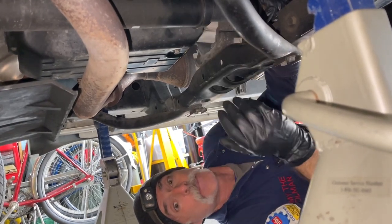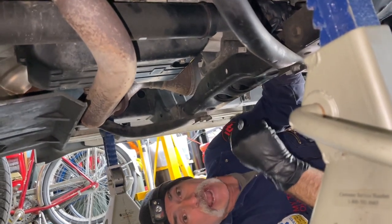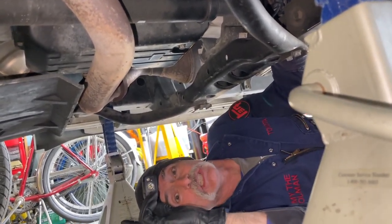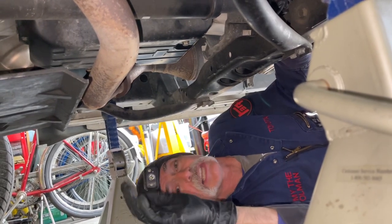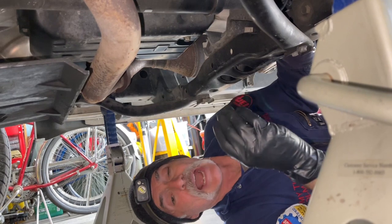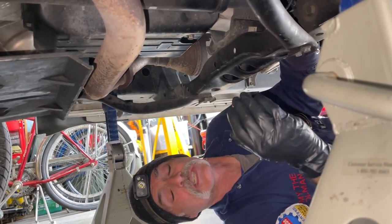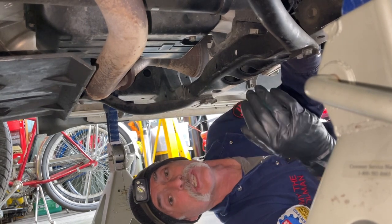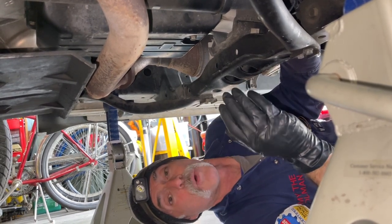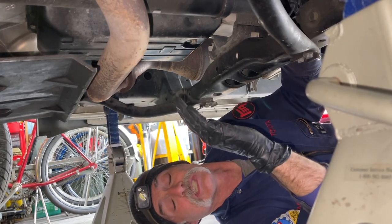The problem is there's some miscommunication from the actuator to the four-wheel drive ECU that's not telling the dash light to go solid. I'll now open up the actuator we got from Andrew and show you the switch that I believe might be malfunctioning — the reason why he's not getting a solid center diff lock light on his dash cluster.